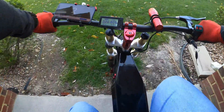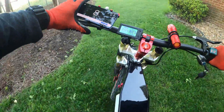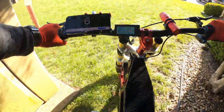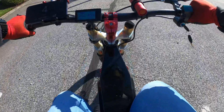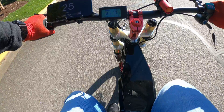Let's make a quick little rip to the front gate. I'll pause right here for a second — just want to show that my battery is only halfway, only at 80 volts. But right here at this clip we dropped down to 77 volts under load and 131 amps. So we're pushing around 10,000 watts right now. Just wanted to point that out and on to the rest of the video.